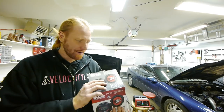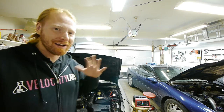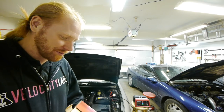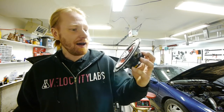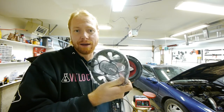I'm not going to show you guys how to do the speaker install — there are already excellent tutorial videos on the Saturn S series online. Richpin's videos in particular are amazing. He's taught me how to do everything on these Saturns. I'm going to pop these in and show you a couple clips once they're in. One tip: put some foam around the outer edge — this insulation-type foam all the way around the inside edge. Because the back of the speaker is metal, it can tend to rattle without insulation there. Put a layer around it and it'll make a big difference on your sound.